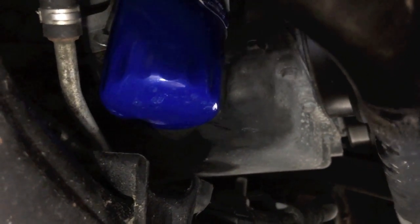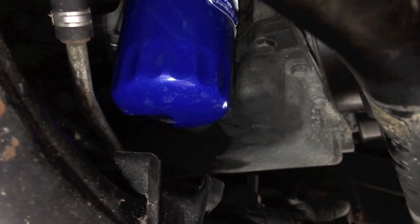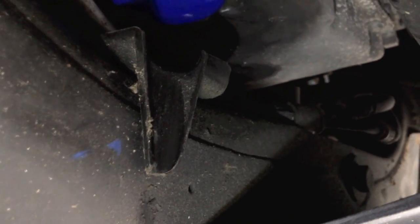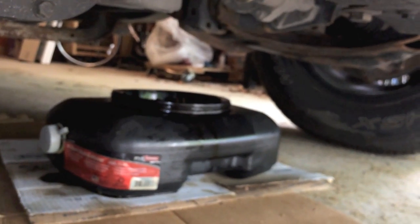Now let's go down below and locate the actual filter. And it's right here. I grabbed a flashlight to give you a better view of it. Grab your ratchet and cap, and those little grooves will actually fit onto the lower portion of the filter. After about 10 to 15 minutes of that oil draining, you shouldn't have a lot of oil that spills out. However, if you do, they've got this cool design to channel the oil through that little spout. So reposition the oil pan after the oil is drained out underneath that, and that will catch any excess oil.